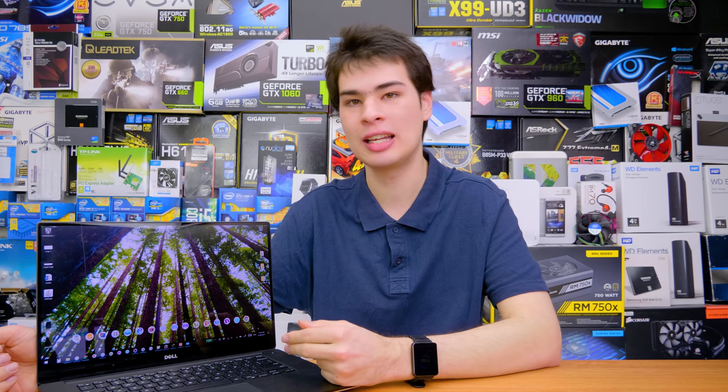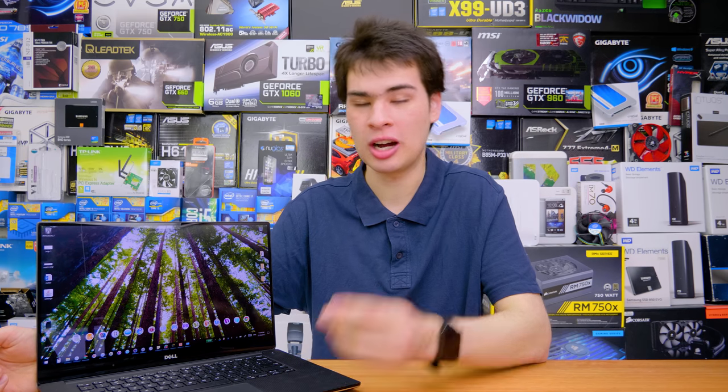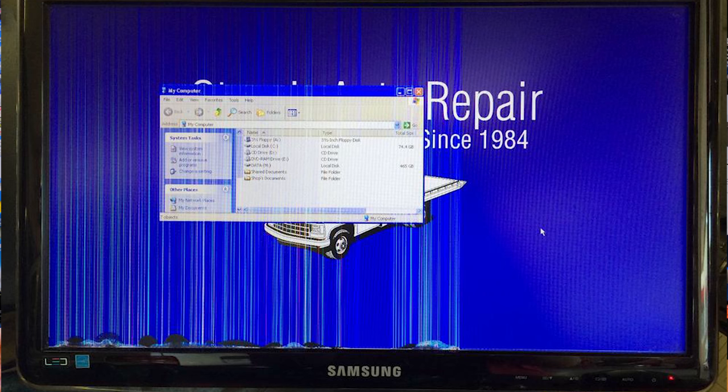Also on the topic of cleaning, try not to use any solvents or cleaners on your computer. Don't use things like Windex, soap, or any kind of cleaner — Windex will actually eat touch screens and the matte coating on matte displays, and other cleaners can eat the plastics your system is made of. The last thing you want is to damage your computer while trying to clean it. Unfortunately I've seen this many times where someone's used Windex on a display and it's basically eaten the coating right off. Most of us have access to warm water, so just use warm water and a microfiber cloth.